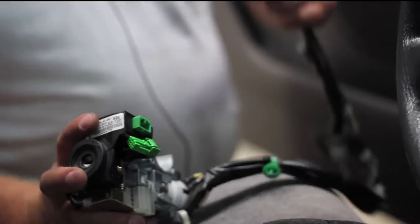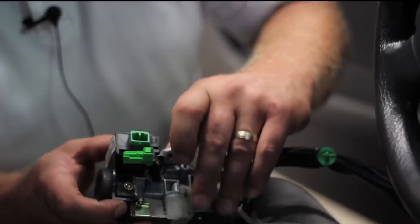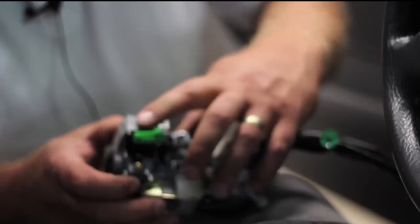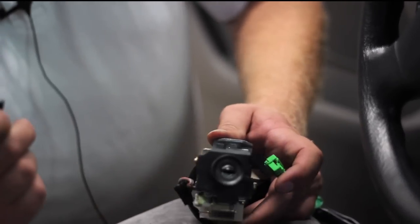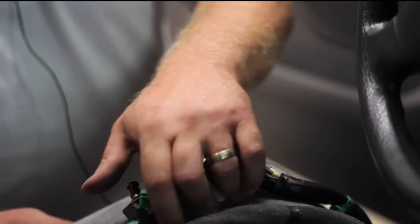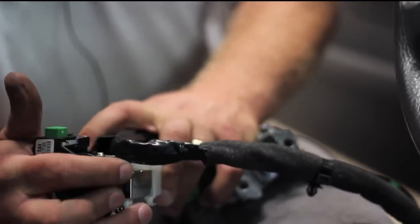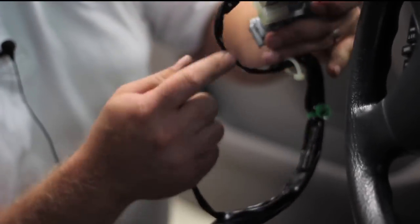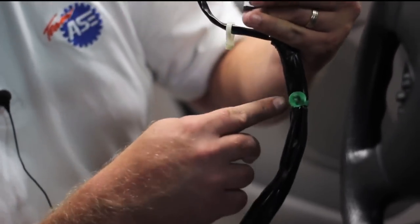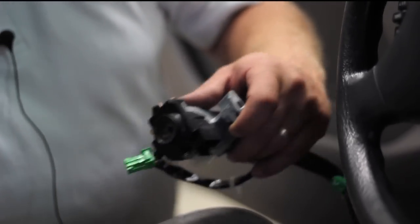Now that the complete old unit is removed, it's time to swap out the immobilizer unit. There are just two Phillips head screws holding it on — one on the bottom and one on the back side. I've already removed those, so the immobilizer unit slides off the old lock cylinder. We simply transfer it over to the new one using the same screws. We're also going to transfer the supplemental wire harness for the immobilizer — cut the tie wraps and tape off the old harness, then tie-wrap it to the new one.